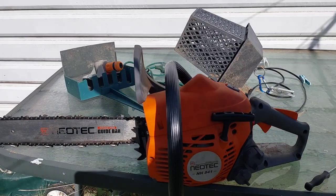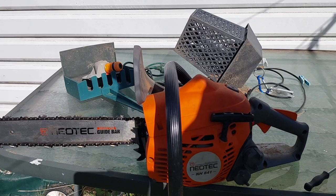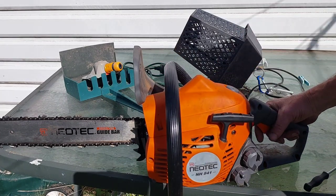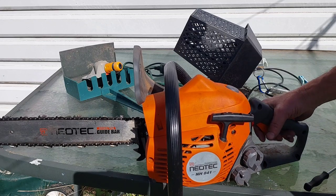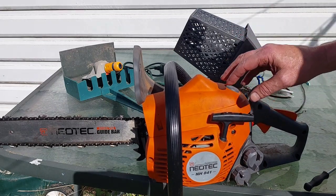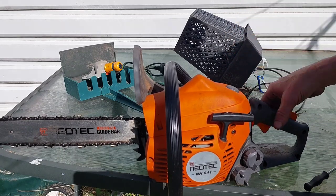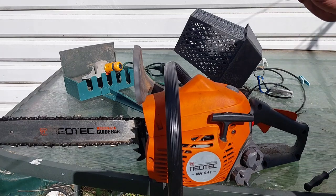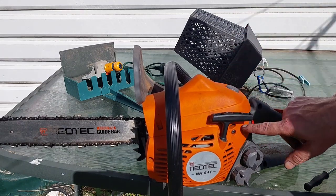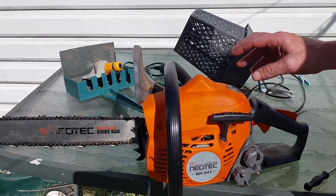Alright, if you heard the saw in the shed, or if you're watching this, thanks for watching anyway. This is my rambling. It started up, but there's a bit of a dead spot off idle. Once you get idling, it's fine. That would be the pulse line, because the pulse line doesn't have full compression, but I don't really care about idle. It's when you're in the wood, that's where it works. If you want to get harder core on this, I'd change the pulse line and throw another carby on with a remote pulse line. But you know, just seeing it will work.